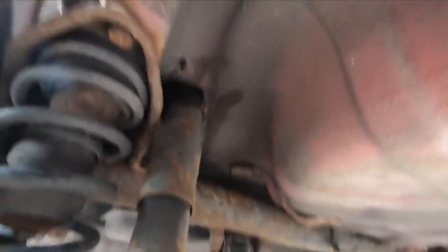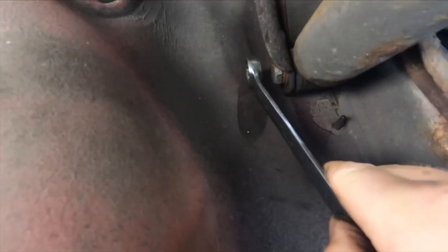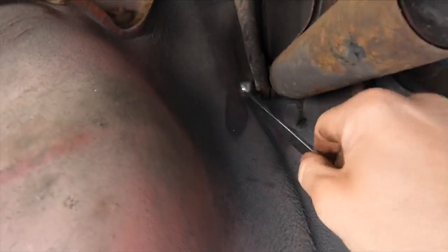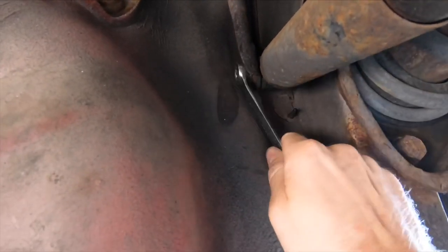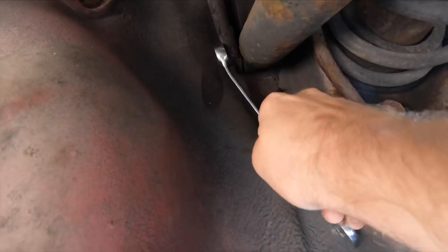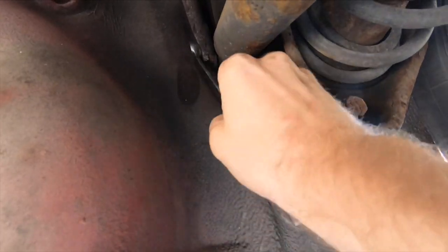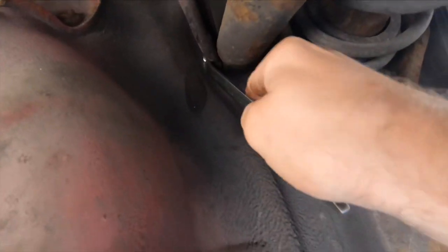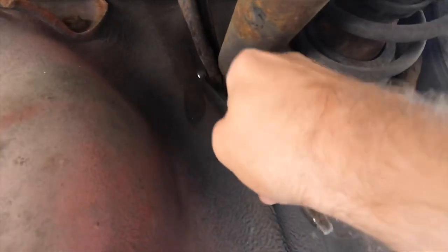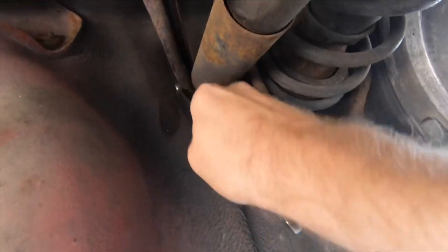Right, stop this. There's going to be someone somewhere that's going to tell me there's a much easier method, but look, it helps clean, so you've got your spanner on, you can turn it that far and then back on and repeat. And repeat, and repeat. Obviously you'll get more room when the bolt starts to come out, but Jesus, that's really irritating. It's going to take me a little while, this one. I'll just get it as far as I can and then get the bottom one out first, so at least it's hanging without dropping the bottom arm down.